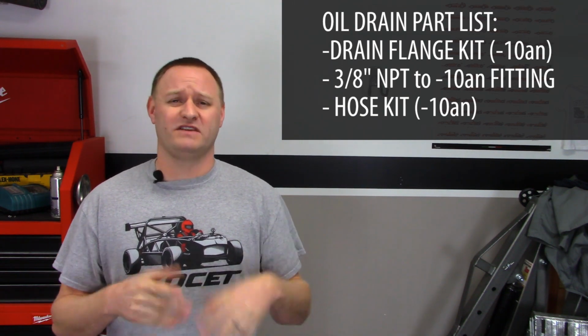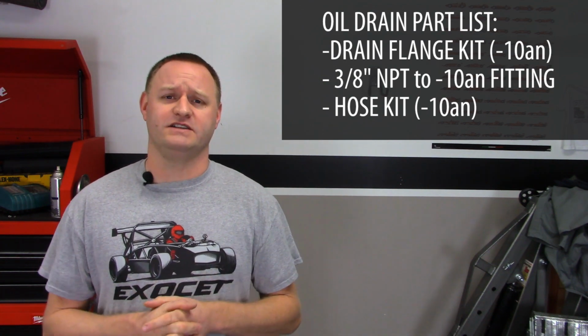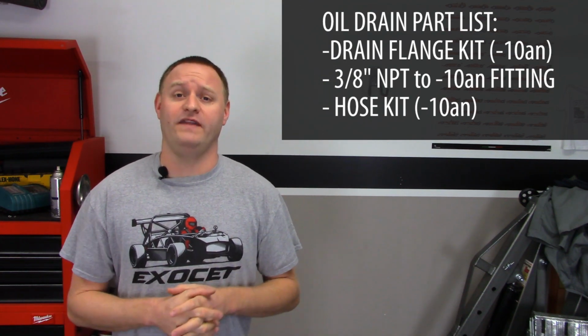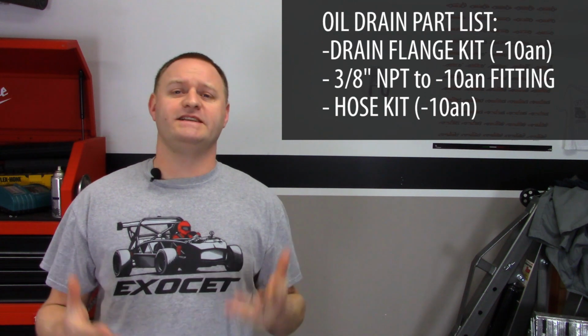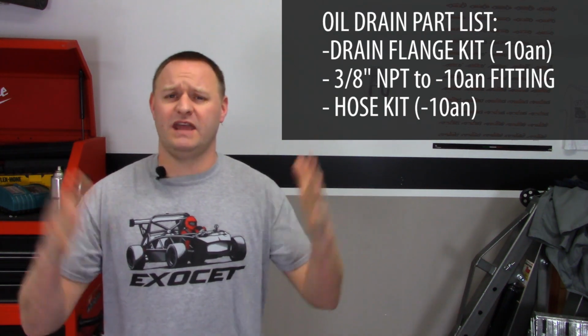So I'm going to have to cover that with some kind of heat wrap, because the heat from the exhaust housing on the turbo will definitely melt that nylon pretty quickly. Basically, this came with all the hose ends, fittings, everything that I needed to make a line, and it came with about 2 feet of hose.